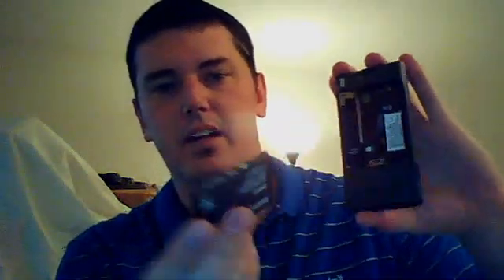Once it's turned off, then we're going to pull the battery out. You really need to let it sit out of the phone for at least 30 seconds. On the phone, if you pull this down it's going to come off like that — this tag right here, you can kind of see it. If you pull that, that'll actually let the battery come out.